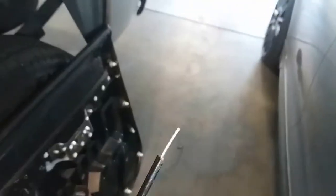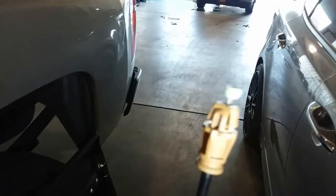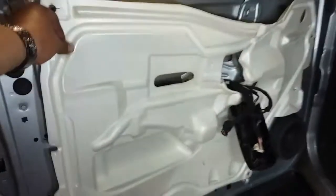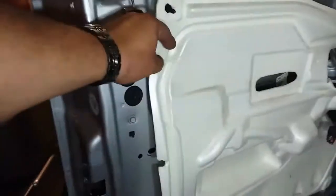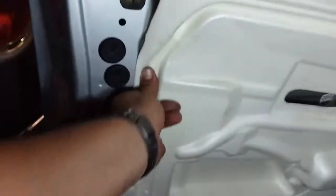In order to remove this piece and the whole cord to replace it, you have to pinch these sides with the needle nose. The way you do this is after you remove the door panel, you have to peel this vapor barrier away — it should stick back on. And there it is, this little tab.